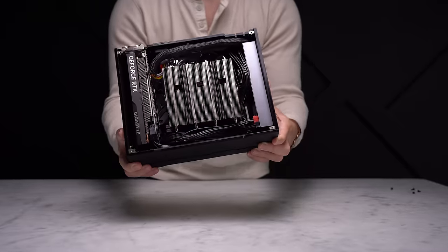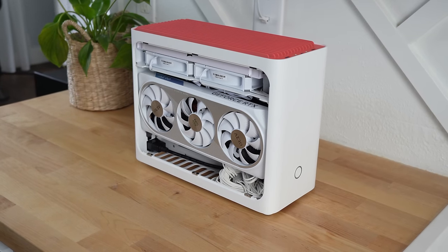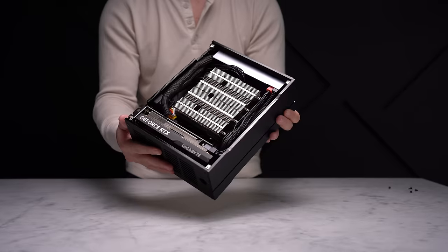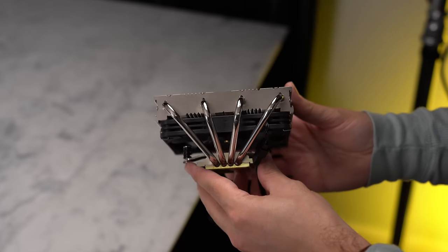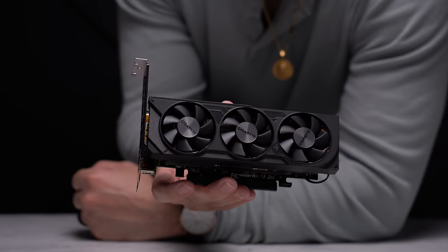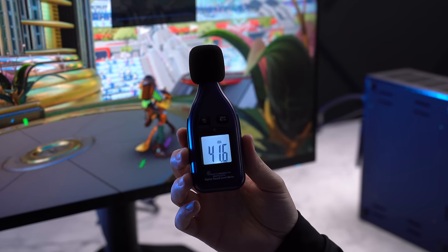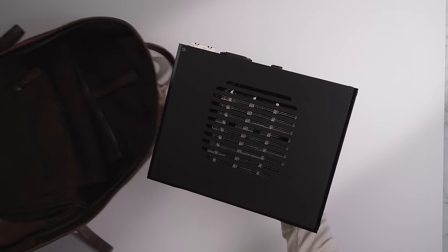With the top cover and last panel placed, the build is complete — and it's a very satisfying one. It was difficult to find a case that took full advantage of the small low-profile 4060, but the Laser 3D case fit perfectly. The 4060 isn't a cut-down version; it's significantly smaller but still runs cool — the triple-fan setup works really well. Under a full gaming load I'm seeing around 41 to 42 decibels on a standard fan profile, and bumping fans to full speed I'm still only seeing around 42 decibels for the full system.